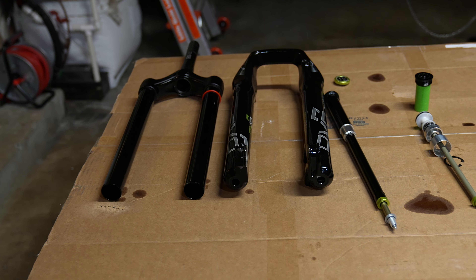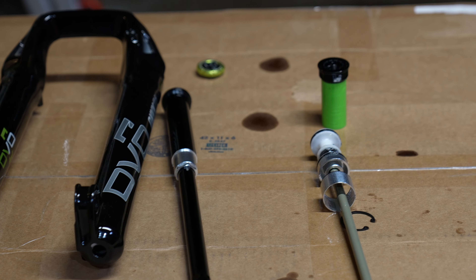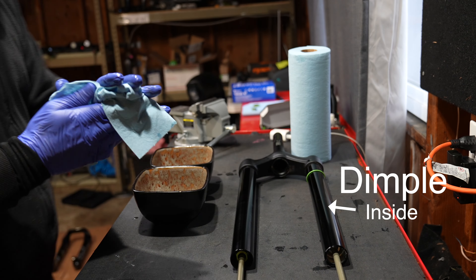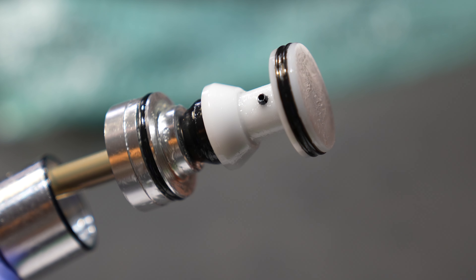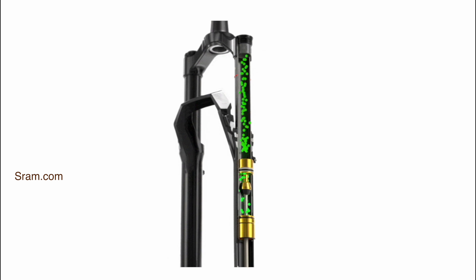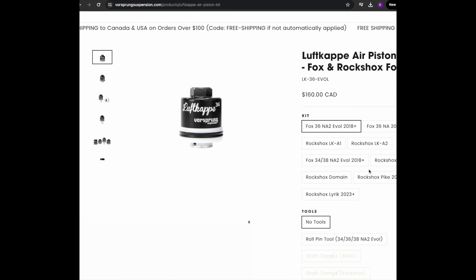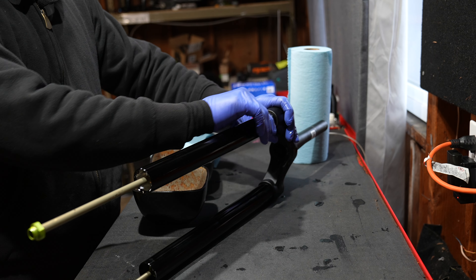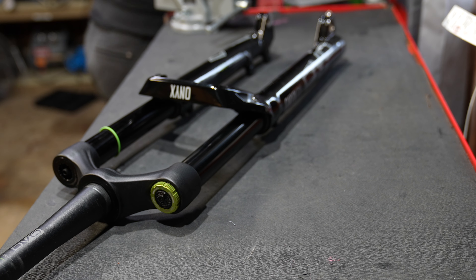The main reason for that call was to ask DVO why the fork felt perfectly balanced — and I came up with that description myself, no marketing. Ronnie explained they spent years developing the dimple location inside the stanchion. When we look at the DVO Onyx 38 air spring it looks very simple — it could go in a RockShox Domain. The dimple location tells the fork when to equalize the negative and positive chambers. Companies like Vorsprung make upgraded air pistons to try to trick the dimple, but when you buy the DVO Onyx 38 you get perfect balance straight out of the box.